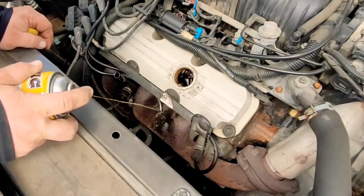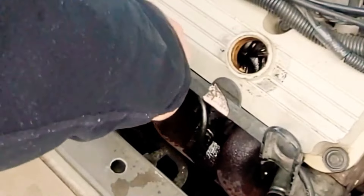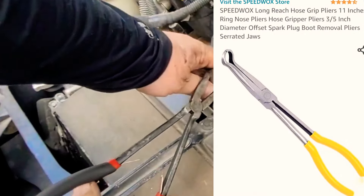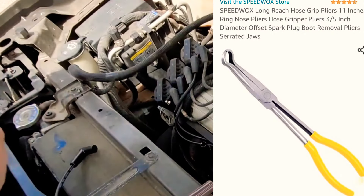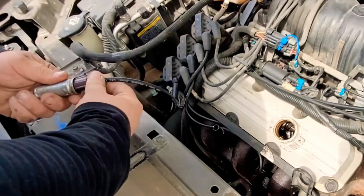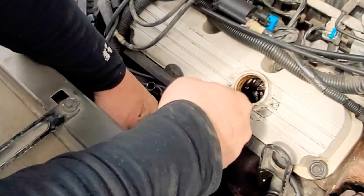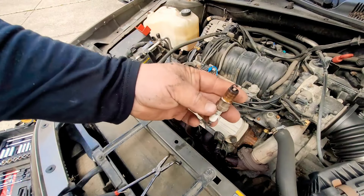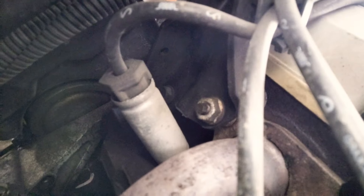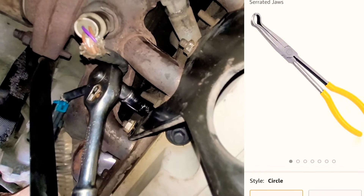Now these front three spark plugs are pretty easy — it's the ones on the back that give you trouble. When I'm taking these ignition coils off for the ignition wires, I'm using a pair of long reach pliers. Makes it a lot easier. I'll put a link in the description — they're very handy, especially if the ignition wires have been on there a long time. Sometimes they'll actually break from the spark plug or pull apart. Here we are taking the last spark plug out, so we're done with the front. Now we need to go to the back. First thing we need to do is remove this little bracket — I think it's two 12 millimeters. And now you can see in the back the ignition wires, and that's where that long reach set of pliers comes in very handy.